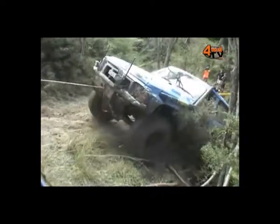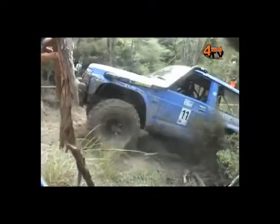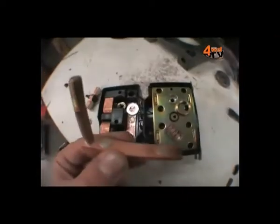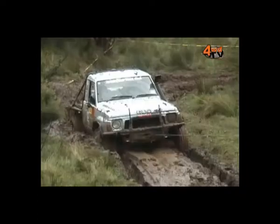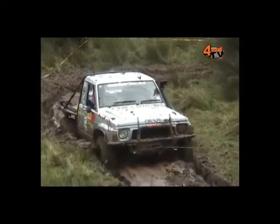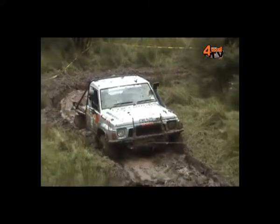With many of the older solenoids you may find only up to a 60% continuous or duty rating, whereas the newer solenoids will take 100% duty for their rating all the time. With the older style of solenoid, you're basically talking 16 connection points, whereas with the newer non-ferrous type box you have much fewer contact points, making it a much more efficient unit — the fewer points of contact, the less current you'll actually lose.